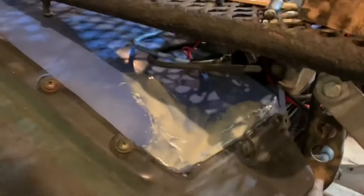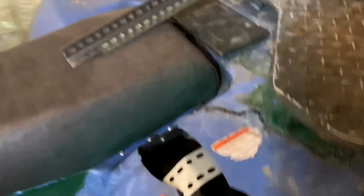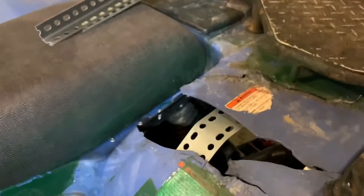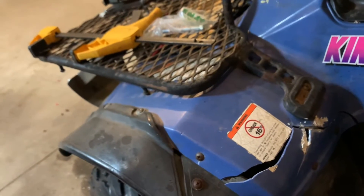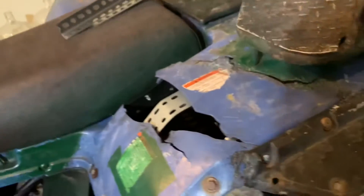I've done a few repairs on some of the plastics. This rear left fender was the worst — it was all duct-taped together, so I ripped all that off and put some metal strapping underneath. I can probably build that back up with fiberglass or something. You can see cracks here, so I've just been working my way around releasing fasteners, fixing cracks, and putting grommets in where I can.